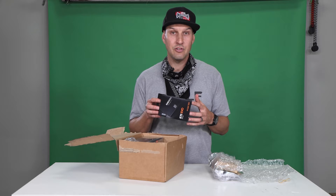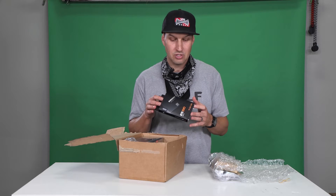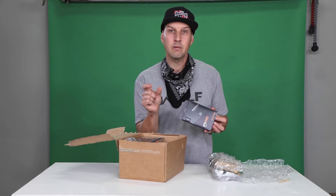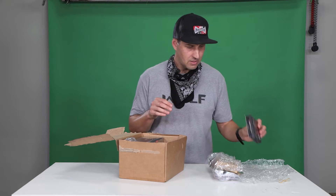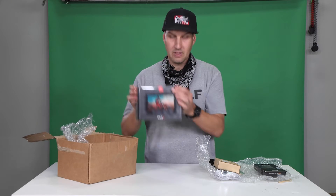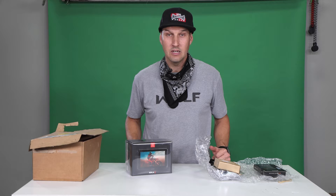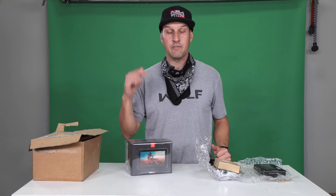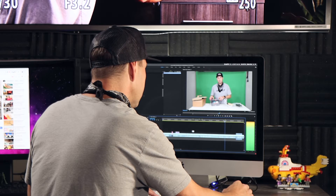I read in a review that you can also use a regular two and a half inch SSD. They're a little bit cheaper and you can usually get more capacity for the same price. So I went with the two and a half inch — it's just going to hang off about an inch off the side of the unit, which I'm not concerned about. The Ninja also takes L series batteries, and I have a lot of devices here in the studio that take L series batteries, so I already have a bunch and didn't have to pick any up. If you're planning on running this off batteries, I'd recommend you get some L series batteries.